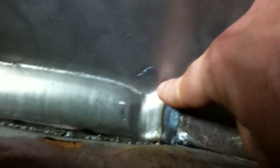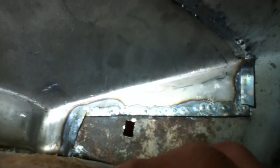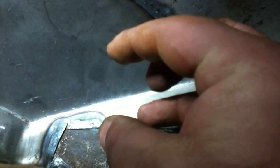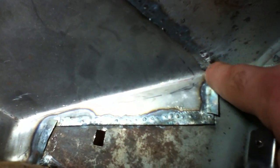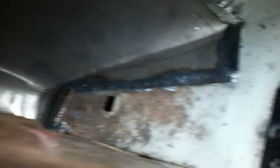Here's the inner side of the lower quarter panel that I flanged on. On the back I had two weld gap pieces — this one piece and another one down here. I threw about a tack or two on and then beat them in place with body hammers. Then I'll come back with a hole saw and slowly shave off what I need to, leaving behind only what I'm covering and what I have welded on. After all that's done I'll come back and sandblast the rest and put seam sealer in so I don't ever have any rust come back through.